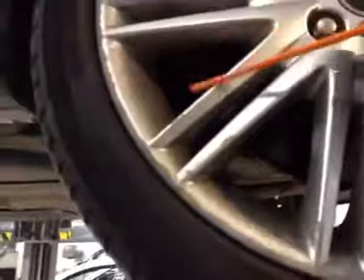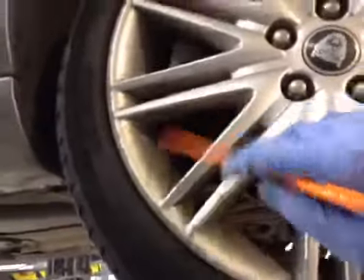The passenger rear tire is again between 3-5mm of tread. No foreign objects inside the tire. Rear disc has a slight lip, and your rear brake pads are roughly on about 5mm. So the pads are in amber, discs are in amber, and the tire is in amber on the health check.